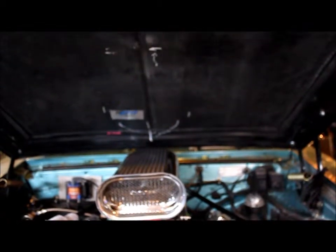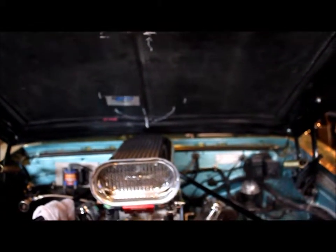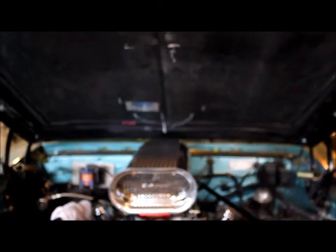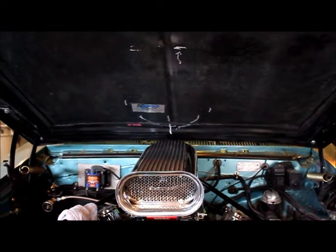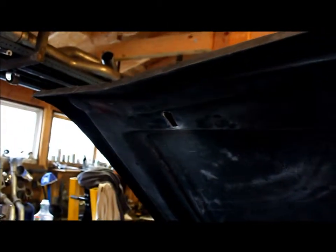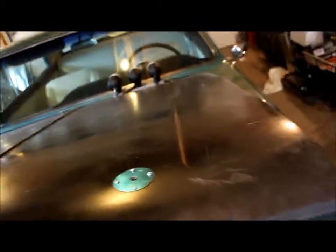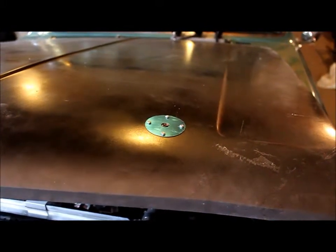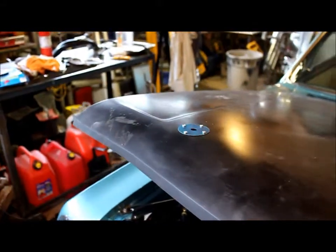There are rough drawings there, but at least it gives me a bit of a guideline as to where I need to be. With these engines and these cars, the engine doesn't sit center, so it's going to be a little off center — as you can see with the one line I've got marked in there. The elongated holes for the hood kind of did that, same as on the other one. Ain't no body man here. And that's what the pin surround collar — whatever the hell you want to call it — is for. Off she comes.